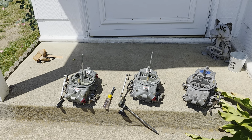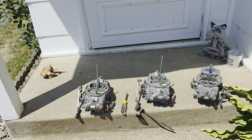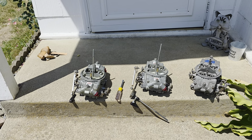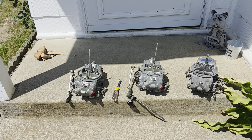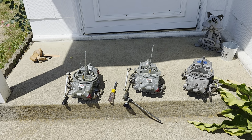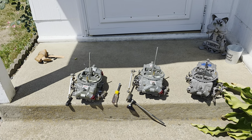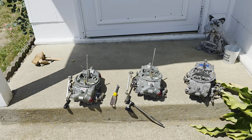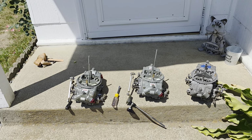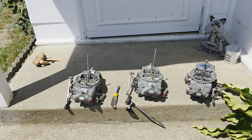So what they do, for anyone's information, there's a number of aftermarket companies out there that build Holley based carburetors, say 4150s, Dominators, what have you, and they have aftermarket bodies on them that have provisions for more jet changes on the top side, air bleeds, I guess you could call it, and in the metering blocks, so they're much more tunable.